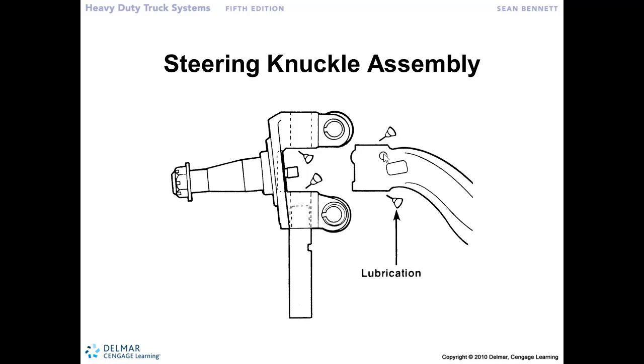It may be that the king pin will go in either way — top to bottom or bottom to top. Make sure we get that king pin located in the proper direction, because this notch is offset toward the top as opposed to centered or down low, so that it lines up just right. You could put this king pin in upside down, get everything pushed all the way through with equal height at top and bottom, and that relief would be nowhere near where the draw key needs to come through. So a lot of times they'll mark 'TOP' on the top of the king pin so you assemble it the proper way.